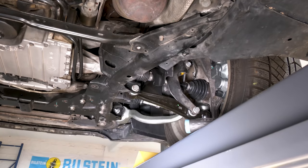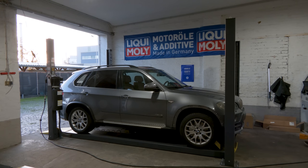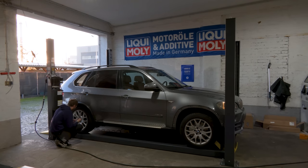And with that, we finished torquing the suspension. Now I'm gonna fire up ISTA and see if the rear suspension needs to be adjusted. There's a calibration process for that. So according to TS, we need to measure from the bottom of the rim flange until the wheel arch and see what the measurement is.